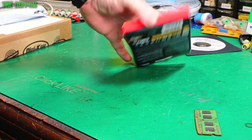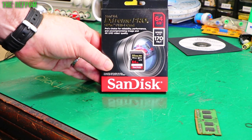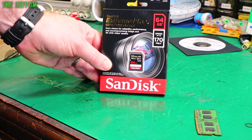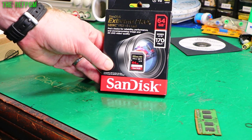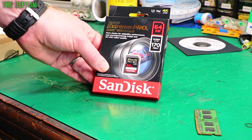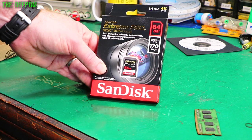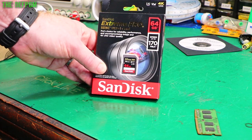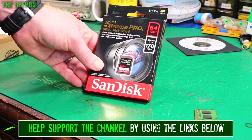This is a local purchase — just a new SD card for my camera, 64 gig. The reason being that my camera has been acting weird recently, shutting off randomly during file saves — the camera's basically crashed. I'm not sure if it's because of the SD card or because I've got it plugged into my monitor and my USB 3 HDMI splitter, possibly powering the splitter from the camera. I've had this camera for a few years still running the original SD card. At the time I originally bought a 32 gigabyte card, but I can now get a 64 gigabyte card for the same money.